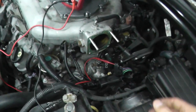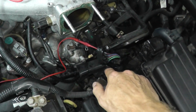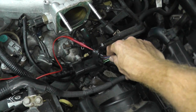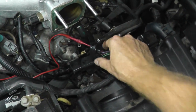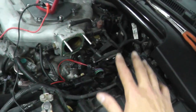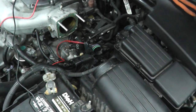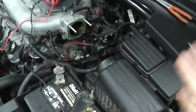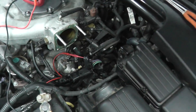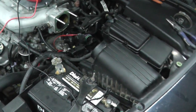If you do this test and you don't see a reading, check the rear of the harness connector. What happens over time is a technician pulls on the wiring instead of the body, which dislodges wiring and causes a host of issues. If everything looks okay but you want to investigate further, you'll need something like a power probe or another tool to find any electrical short — but you may just want to bring it to a good garage.